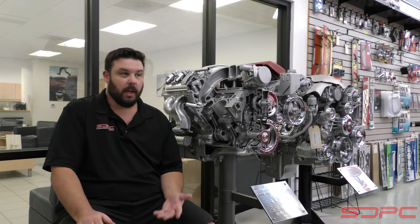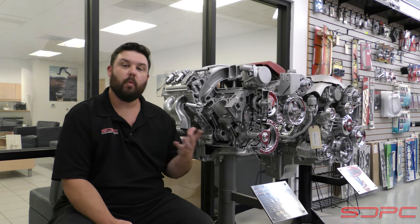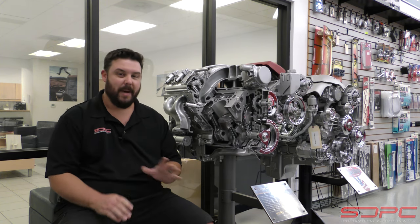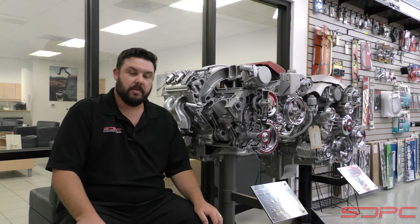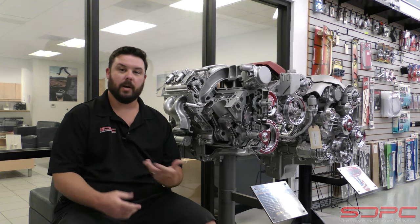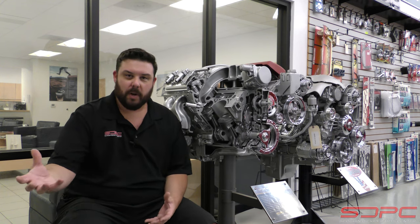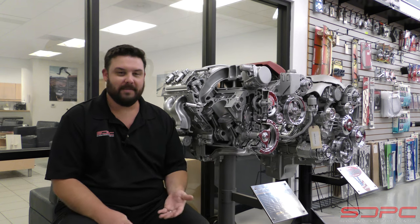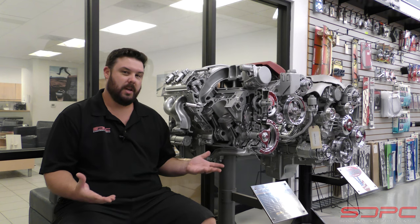So what do you do? In-town driving. Drive it like you would every day — run it through the gears, run it back down through the gears. You're not going wide open throttle, but you're not babying it either. You're finding a middle ground. There are some heat cycles these things go through. Some people like to run it for 20 or 25 miles, turn it off, let it cool down, fire it back up, and restart — and we've seen that method work as well. That's why you hear the controversy: 'no, this way works' — 'no, that way works.' They both work. As grotesque as it sounds, there's more than one way to skin a cat.